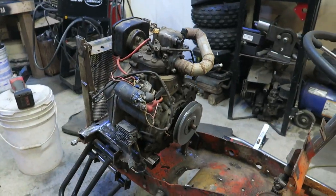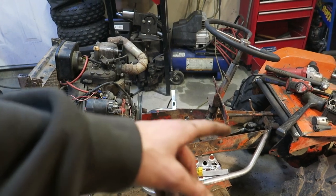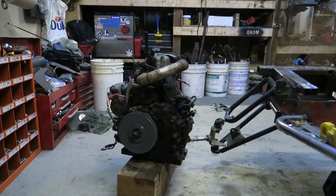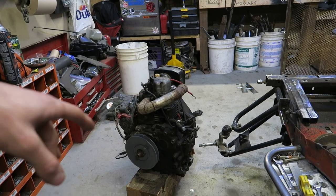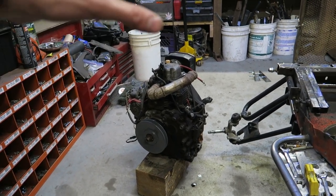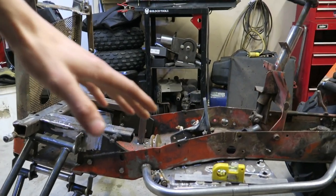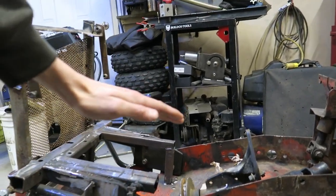So mucking the engine up in here — let me just say, this just looks way better. Let's get this engine bolted in, get the drive shaft set up, and go for a test drive. The next day has started. Last night I did some research on my little 10-horsepower diesel — I figured out what I need to do to get it running and what I need to clean. I did pop the oil and there was water in it, so I'm going to have to open it up and clean that out. Now, actually having the motor installed on the plate, since the frame has been re-welded at a somewhat tilted angle, the engine sat at an angle, which means the drive shaft would have to be cocked up way too much at a weird angle.